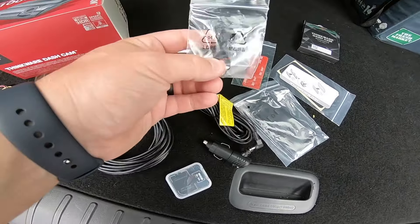This specific install has a heat blocking shield — it's a piece of black that goes on your windshield in the location that your dash cam is going to go, and then you stick the dash cam to this. The camera app wants you to use Thinkware Connected, but since that requires an account, we're going to use the other app, Dash Cam Link from Thinkware. That gives us the ability to align the camera — it's got lines on it so you can determine where center is. There is a delay, so every move you make, wait a couple seconds.